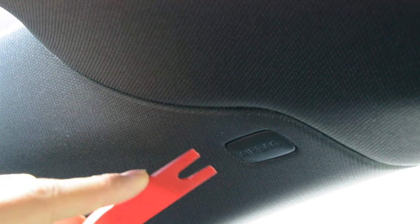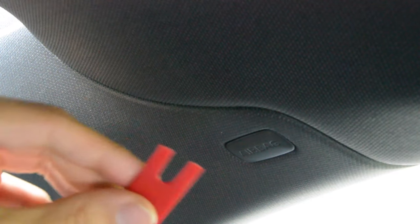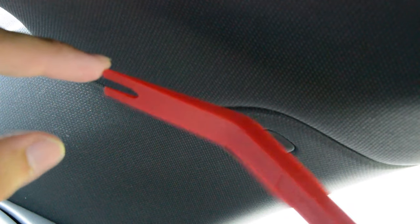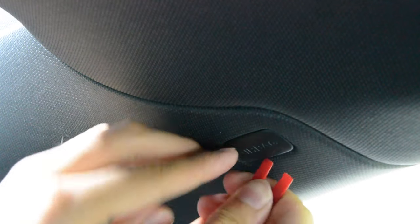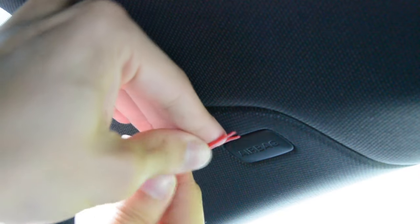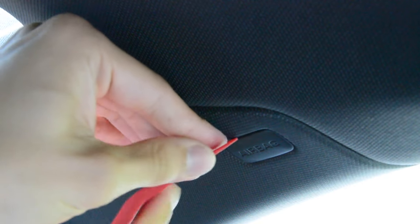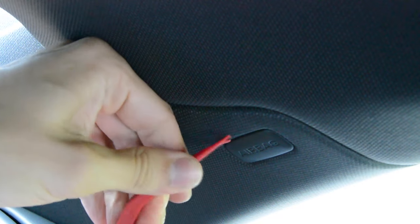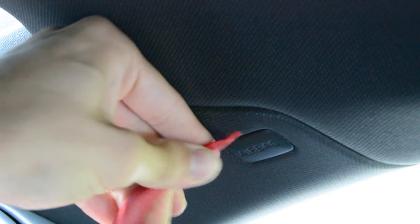I will leave a link to this kit in the description of the video. And you want to use this very thin one that has this on one side and that on the other side. It's a bit formed like this, and then you just want to pry under here until you start really getting under it. It's really, really hard in the beginning, but the clip will loosen the further you pry. So just try it over and over again. The clip will come loose eventually.